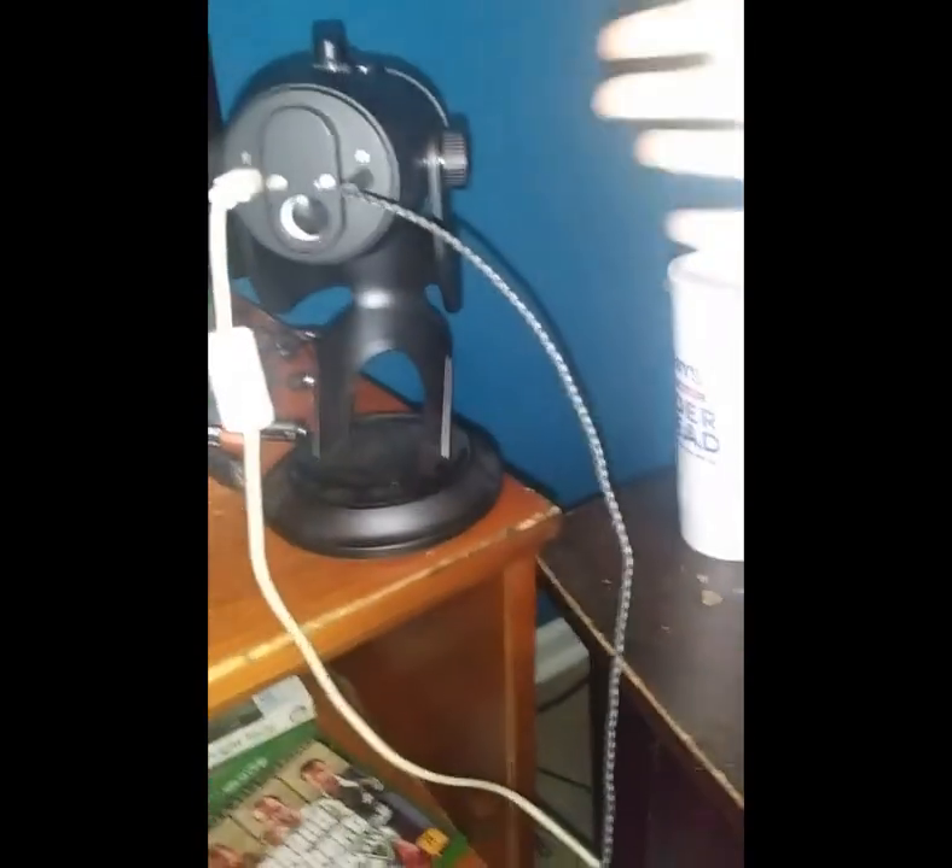Plug that in where your mic was, right here. And take the other end of your aux cord — there's a bottom part right here, you don't want to plug that in. Take your headset, the aux cord should be in there, and you take this wire of your headset and plug that headset wire into the adapter. So you've got the headset, you've got the aux cord going into the Blue Yeti, and then you've got this going into that.